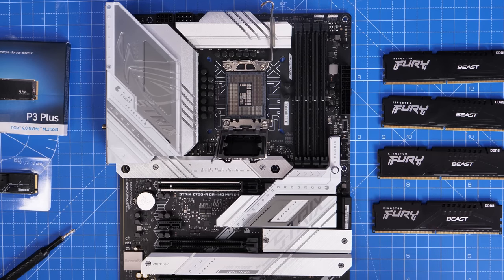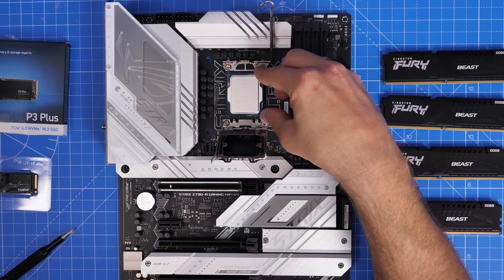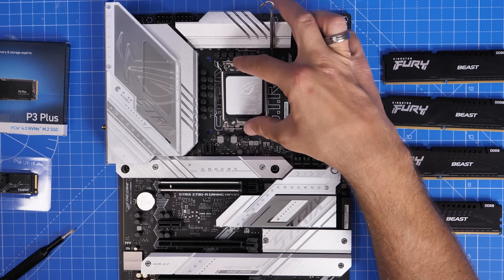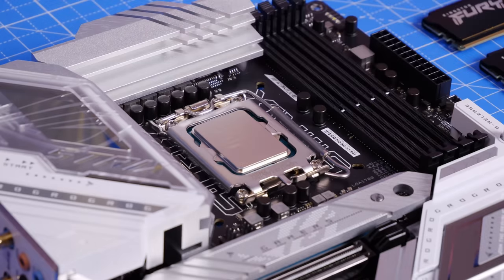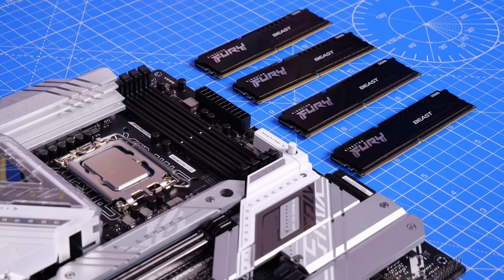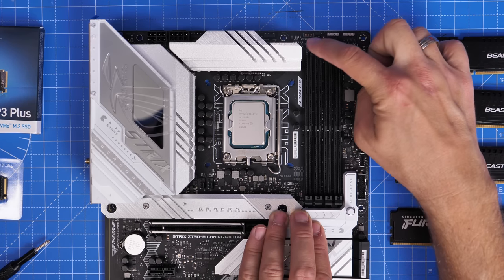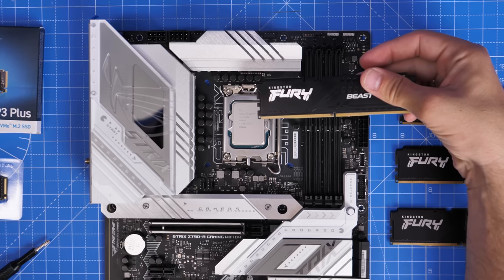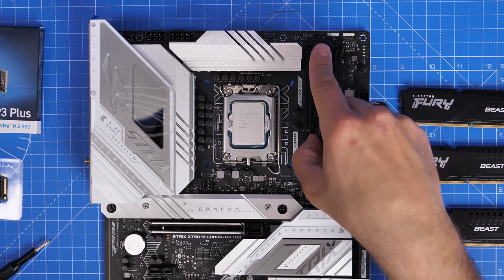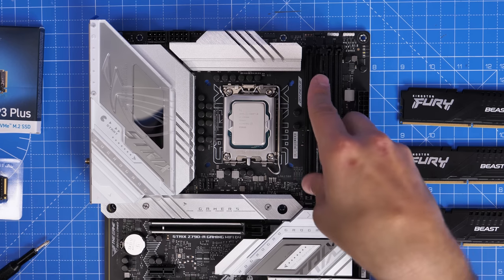The problem is that this motherboard takes DDR4 RAM and I only have DDR5 RAM. I wasn't aware of this before I started unboxing the motherboard, even though it is actually on the box and in the manual. DDR4 is ever so slightly different from DDR5 — the notches are slightly different and it's not immediately obvious when you look at the board. When I went to install the RAM and it wouldn't fit, I thought I was just putting it in the wrong way. You'll see that clip here as a blooper reel. It's because it's entirely the wrong RAM. DDR4 will fit in here; DDR5 will not. Do not try to force DDR5 into a DDR4 slot or vice versa — it will not fit and it will not work.